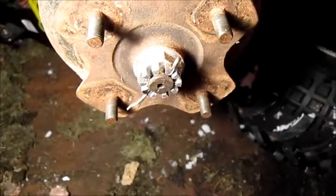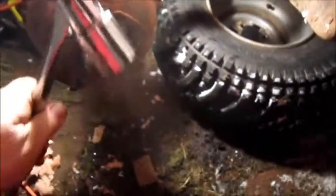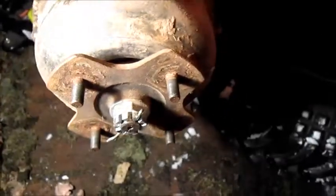Back to the hub — I got the rear wheel off and this is what it looks like. You've got a big honking hub right there. Fortunately, you've got a big honking 30mm socket and a half-inch L-bar. I didn't have those and I got lucky — Canadian Tire had a sale. There is the rear wheel hub; that's got to come off to get to the brakes.